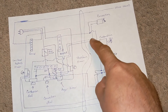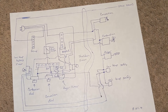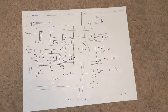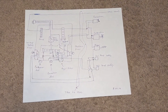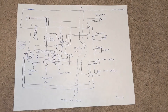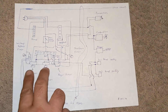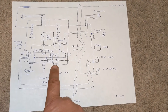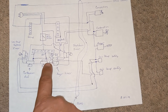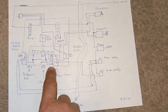Just pick which pin you want to use on the plug — no big deal. Make sure your wires are completely inside the plug with nothing exposed. This is 110 volt, not 12 volt, so make sure nothing is going to touch — you can start a fire, you can electrocute yourself. If this intimidates you or you don't know what you're doing, don't do it. Those two switches give me combustion fan and convection fan, then the auger timer takes power run down through the plug.